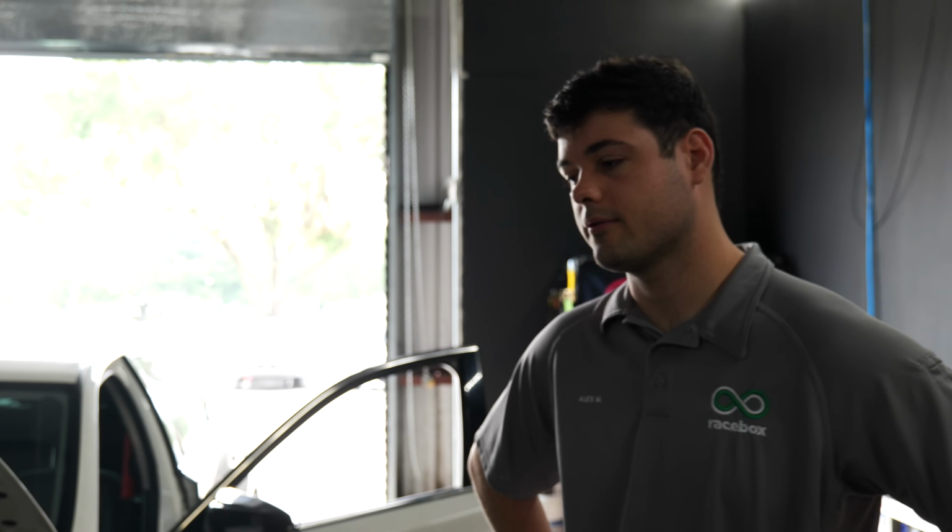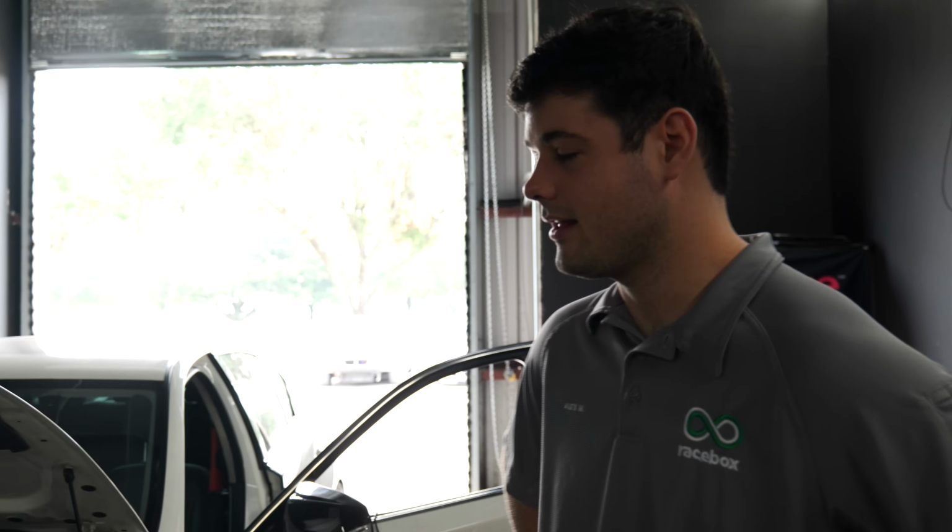I haven't had a setup that allows me to really push the turbos to their max, but I know they're good for more than 32 psi as they sit. Probably, if we were to just close the wastegates and go full send, they'd make close to 38, 40 psi. I don't think they're ever going to do that though, just because of the back pressure on the VR30 with the head design. But overall, it's a phenomenal turbo. For anyone wanting over 700 wheel horsepower on a stock block, I think it's the perfect setup.